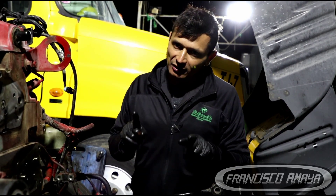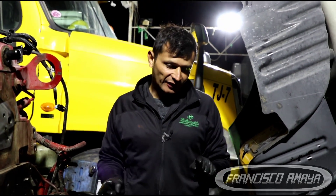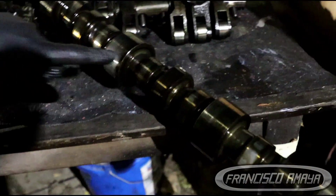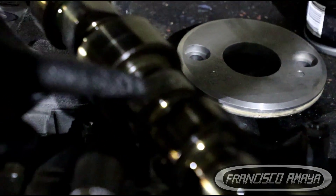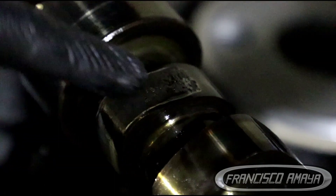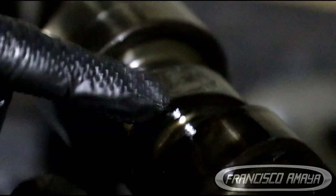We also have another common problem — the camshaft itself. In this case, we have a damaged camshaft right here, with a damaged lobe. It's very dark right here, but this lobe is completely damaged. This is the reason why we are going to get different issues with engine performance, because this lobe is not completely flat. You can see the gaps on the side, and that is not good.